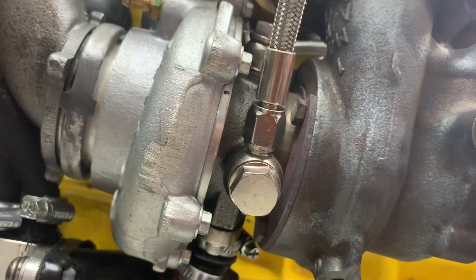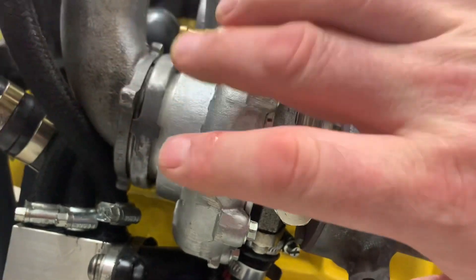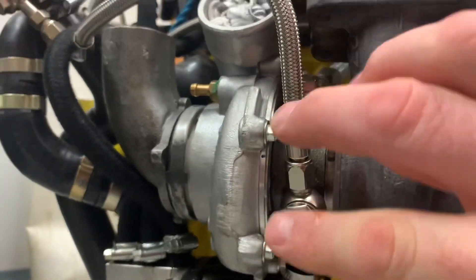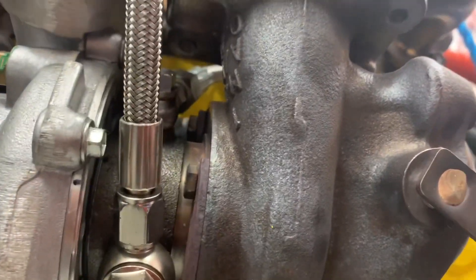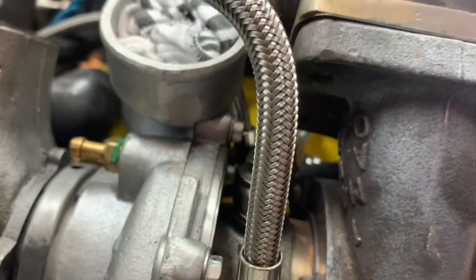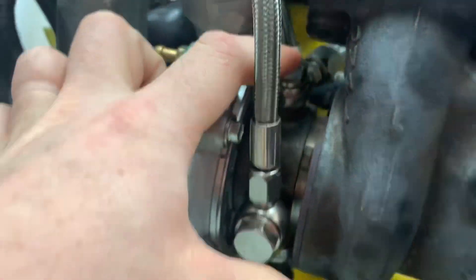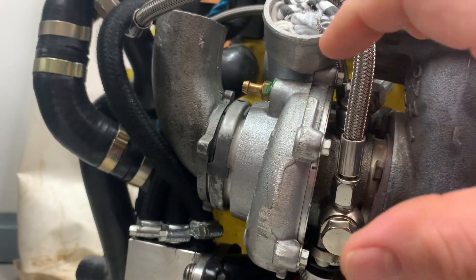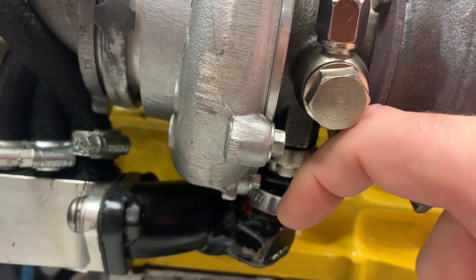My lack of knowledge with turbos has led to this being the way it is. I knew that the compressor housing could be spun round — you simply loosen these bolts all the way round and you can spin the compressor housing on the turbo so this pipe can come out anywhere you want. But what I failed to realise is you can also loosen these bolts and spin the centre section round. I don't know how I've missed that. There's the oil feed coming in at the top and the drain at the bottom, but it's not perfectly straight — the oil should be right in at the top, drain out the bottom. So when I spin that section round, it means the drain is going to be further out over here.